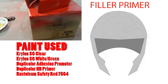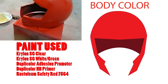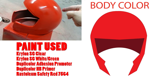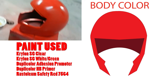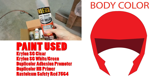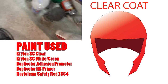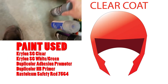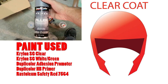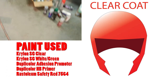You're probably going to need to sand and re-prime multiple times to get rid of all pinholes - you want to get rid of those before you put paint on because once the paint's on it's there forever. After that put your base coat on in thin coats: thin first coat, then after it's tacky another thin coat, then a slightly thicker third coat. If you want a clear coat over the enamel, do the same - very thin first coat, medium-thin second coat, relatively thick third coat. Cure time is 24 to 72 hours depending on the type of paint.